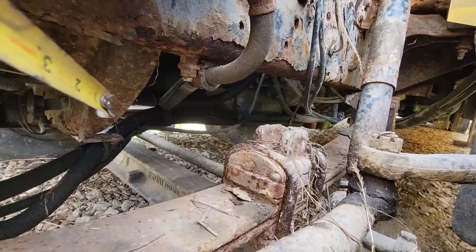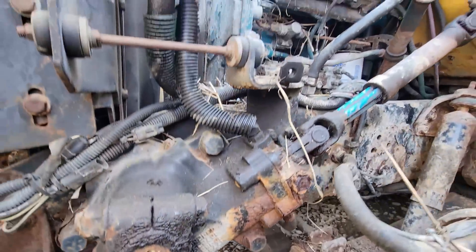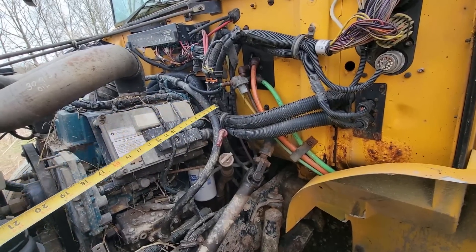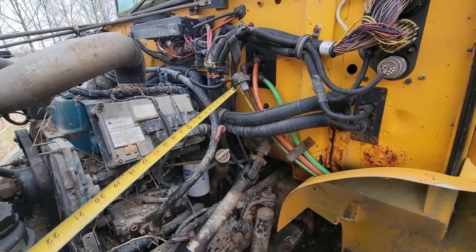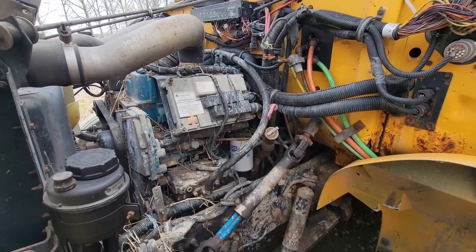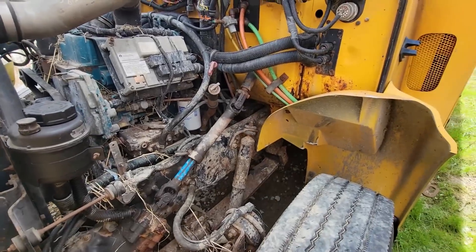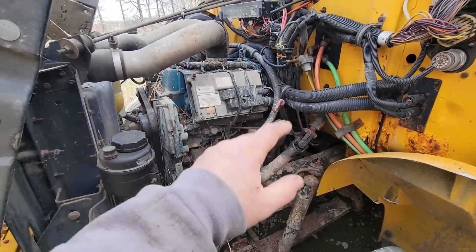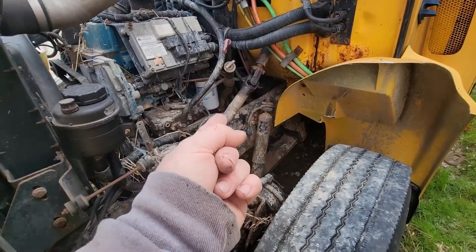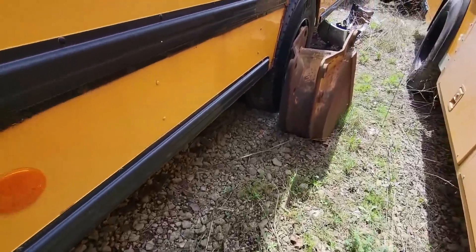The engine is set down on the frame low but I don't know that it can't go any lower. The whole way this engine mounts is on cradles - the intercooler is on a cradle, the front engine is on a cradle, and the back is on transmission mounts with the rear transmission hanging off the back of the motor. We have quite a bit of clearance between the oil pan and that front axle. This was a low chassis bus, so we might be able to drop the motor down more and put a skid plate on it. The lower we go, the less width I need to get the motor under my cab.